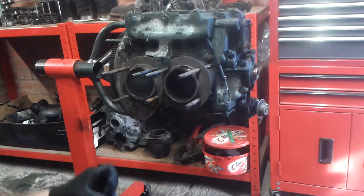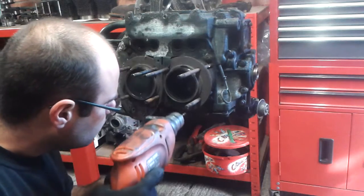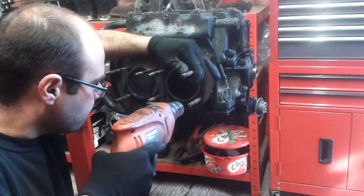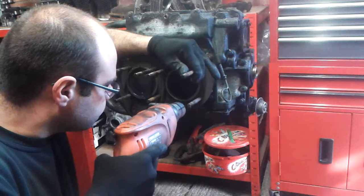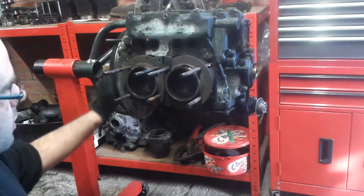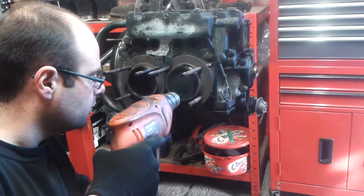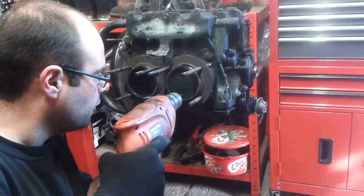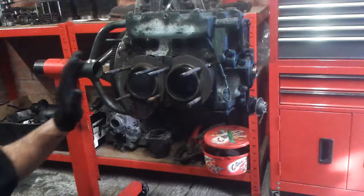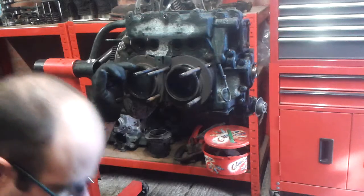There's a very faint mark, it's not going to interfere with anything, and I do the same on my cylinder. I know that's number one. I'm gonna do the same on number two — two marks on piston number two. This way whenever you wash it, clean it, or scrape it, the mark will always stay there so you know where it came from.